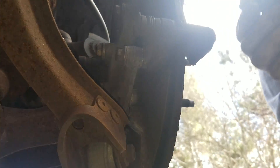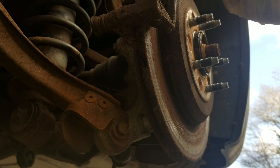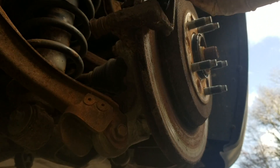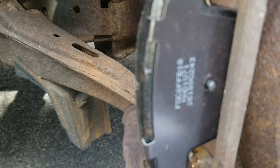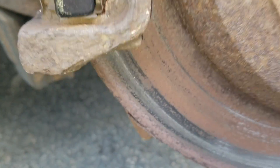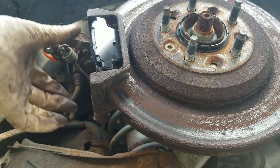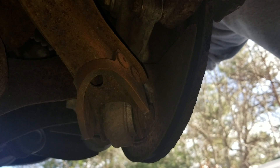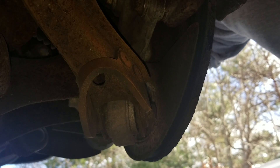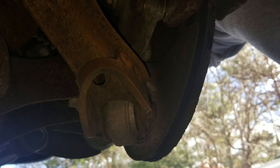Be careful — don't touch that rotor surface. Reinstall your brake pads. I like to do them at an angle — on this particular vehicle you've got to kind of angle it in that way, so the brake pad goes up against these little spring mounts right there. Nice — went in really nice. Same thing on this back side here, angle it in. That's how it should look — not how the rotor should look, but that's how the pad should look.